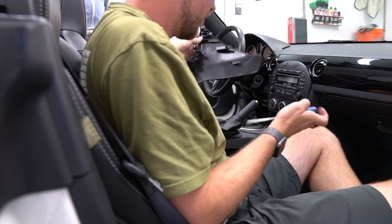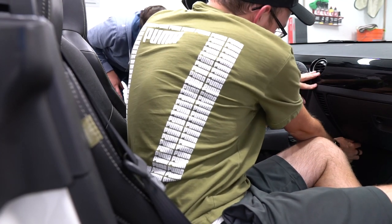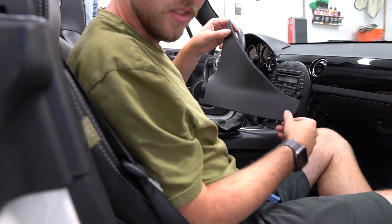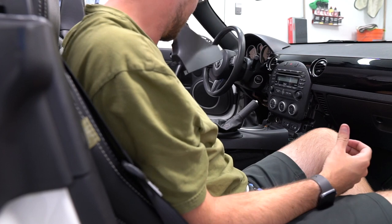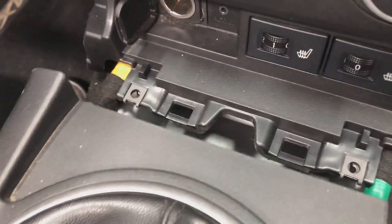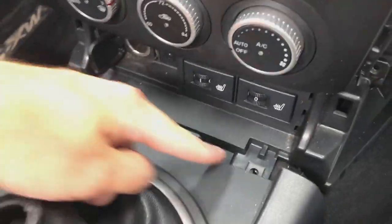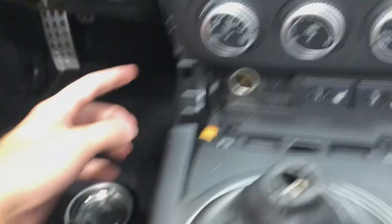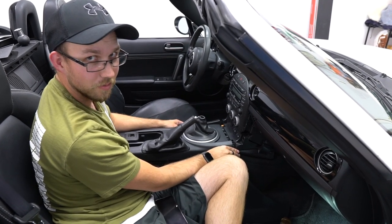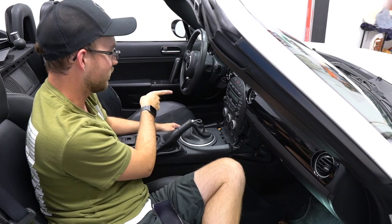There's one wing and the other. On the NC1 these just come off by themselves. You do have to remove them just to get to these two screws — right there and there. Then I took out these screws here and here, and there are a couple more on each side. Theoretically there's a really hard-to-get-to bolt on the back of the radio coming in from the steering wheel side.